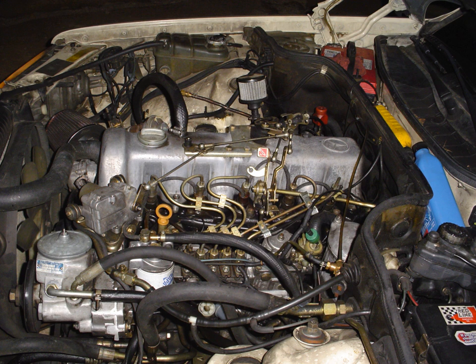The North American engines had ADA device-equipped pumps which limited fuel at high altitudes to prevent smoking with less dense air. New engine blocks after the .910 had rear-mounted oil filter housings with a combined full-flow and bypass filter element. In August 1978, the pre-combustion chamber was updated to be similar to the new OM617A design for more swirl and more efficient combustion. The engine capacity was lowered to 3.0 L to satisfy engine displacement tax laws in Europe by changing the bore to 90.9 mm.